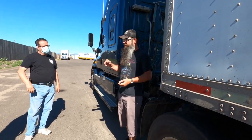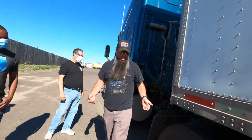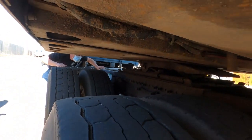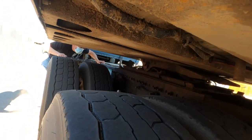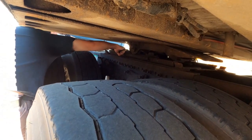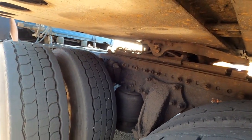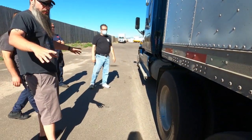So in this case, this is where a good fifth wheel puller is useful, so you can save your arm. I don't have one right now, so I'm gonna have to just do this the old way. So what you're gonna do is you're gonna come down, and on that release handle, you're gonna give it a good yank, okay? So sometimes they can be a little bit of a pain and tight. You might have to rock the truck back and forth a little bit before it'll break loose to get it going. But ideally, you want it to come out fairly easy. So you're just gonna grab the handle, give it a good tug. There you go. See how it locks out like that? That means that we're unlocked now, okay? So it'll stay out like that. If you gotta give it kind of a good tug there too. So now we're released from that.